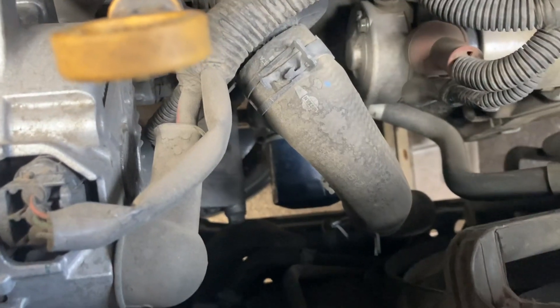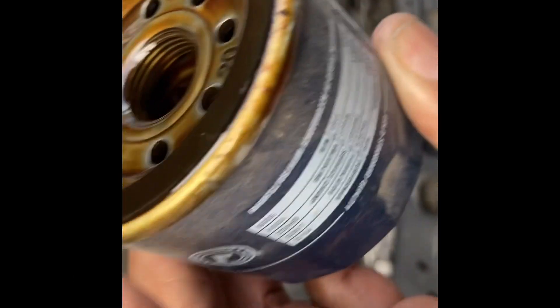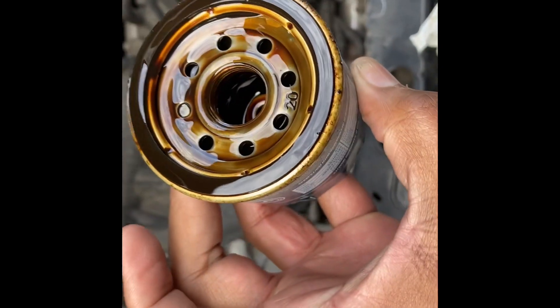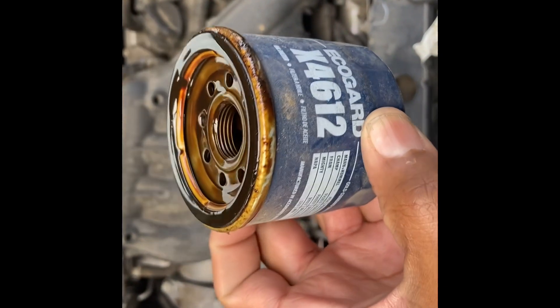You just put your oil filter wrench on there and you're going to turn it to the left. Hang your little drain pan back up top. You want to make sure you got your oil pan right up under, directly under, to catch the oil. Make sure that old ring is still connected to the old oil filter. This black ring — you're going to make sure that it's on there, because if not, oil is going to be getting slung all over the place when you put the new one on there.